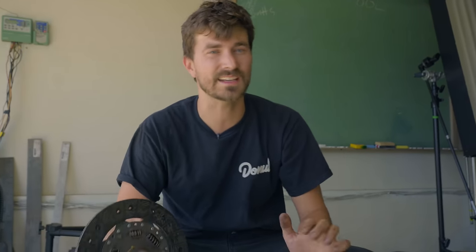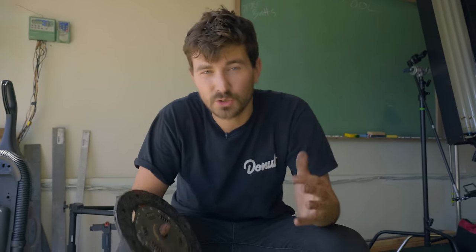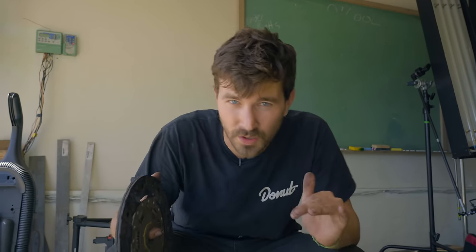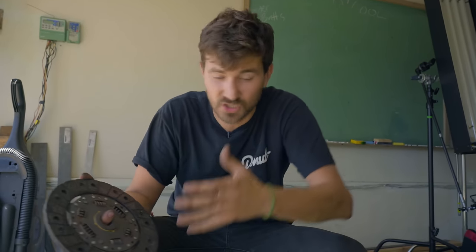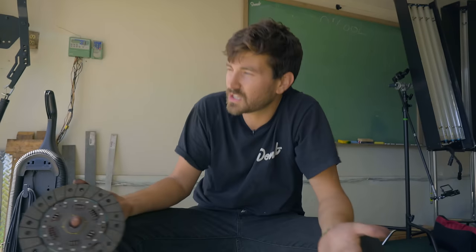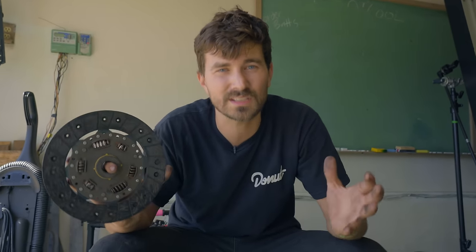I just want to take a break from the madness and give you guys some honest advice on what you should do if you're looking for a clutch. First, be honest with yourself about how much power you're making or intend to make. Once you know how much torque that is, you can select a clutch that can hold that much torque. Basically, get a clutch that'll hold the torque you're gonna make without being too far overkill. In the Miata, if we had put a clutch that could hold 500 foot-pounds, we'd be dealing with a whole bunch of drawbacks we don't really need. Just get what can hold the power you're making and do it as comfortably as possible.